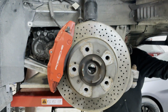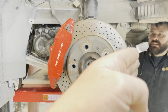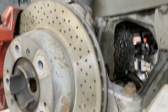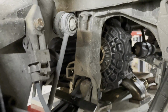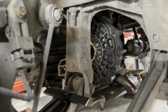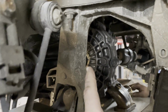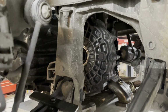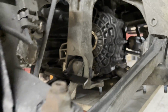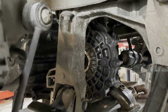They were pointed backwards. So what I figure is, if we recreate this axle angle, the same angle that was pointing backwards, but now pointing forwards, we can reach the Honda diff. But there's a piece of subframe in the way, this guy right here. This guy being in the way is originally why I didn't think that it would be feasible to put the Honda transmission in, because it is right in the way of where the diff is. So the solution to that would be make a whole new subframe. Unbolt the original Porsche subframe, make a new one that will cradle the engine and give us the clearance we need to run a drive shaft through that area.